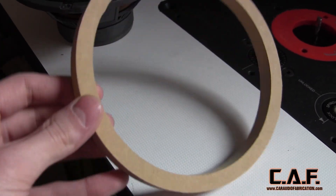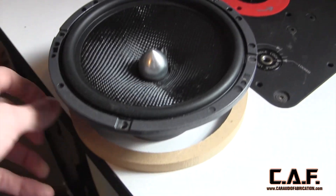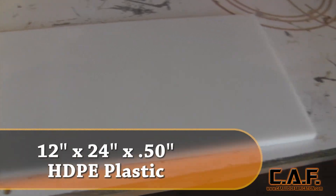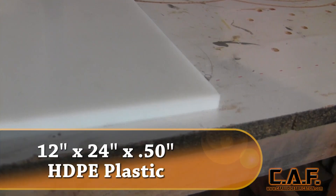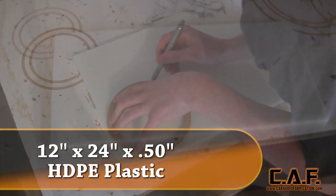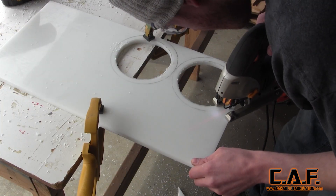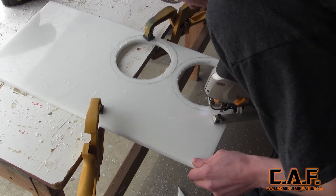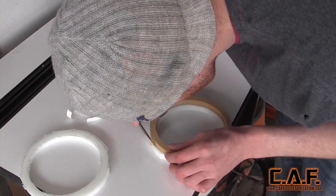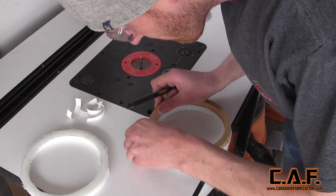Here I have a speaker ring that fits my speaker perfectly. I made it using the technique for creating perfect circles uploaded on my channel — link in the video description. Since our template circle is made out of wood, we need to transfer it to high-density polyethylene, also known as HDPE. Much like the backer plate, I start by drawing an outline on the material and then rough cutting it with the jigsaw. I then stick my template to it, which will allow me to make a copy on the router. It is important to cut away any extra template tape so that it doesn't get wrapped around the router bit.